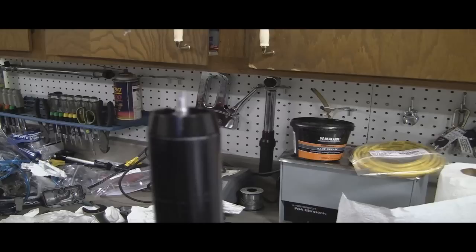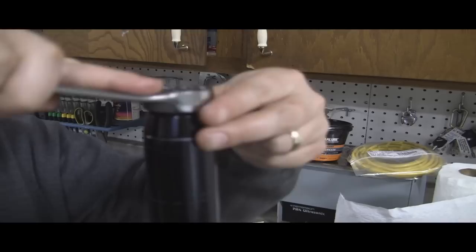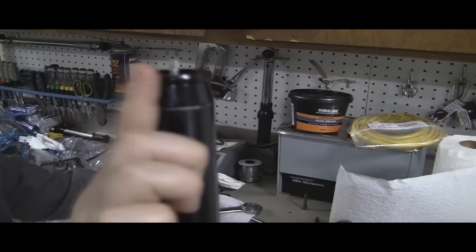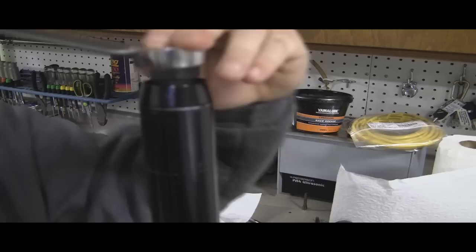Okay, we're back as promised. Now if you've got a lockout, the next thing that goes on would be your lockout — we're going to temporarily put it here. The reason why you don't want to tighten this down all the way is because those two metal flanges we put on actually control the position and tighten the whole thing down, letting you know where your lockout's going to be. So there's where the lockout would be completely locked, and there's where it would be opened. In relation to your fork, it depends on where you want it — you want the open position here and the closed all the way up. This is why you don't want to tighten it all the way, because otherwise you will not be able to move your lockout position.